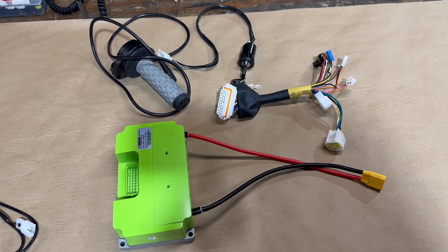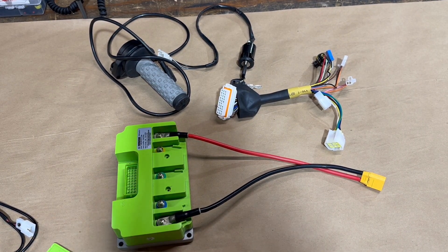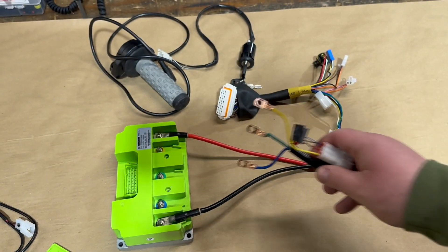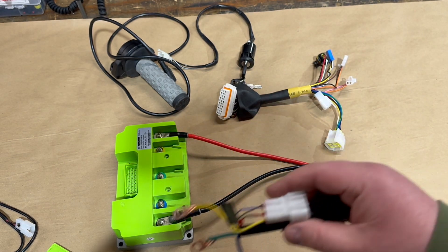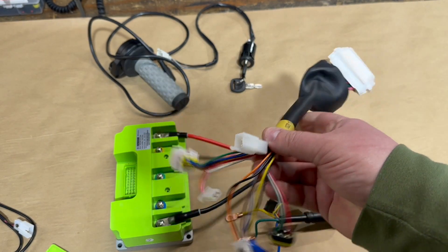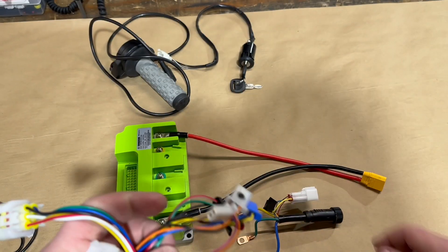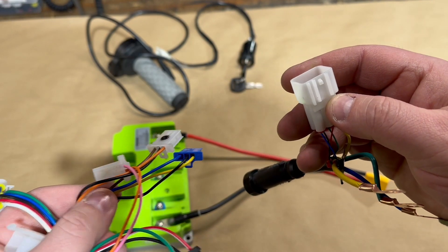Here's the Far Driver controller with the lid off. This is where our phase wires go, and we have our hall sensor wires on a plug. I took the Burromax wiring harness — we line up the phase wires, and then the hall sensor plug goes with the Far Driver. The Far Driver has all different connectors; you don't need all of them, but this big end goes into the controller and you use what you need — the main one being the hall sensor to work with the factory Burromax motor.